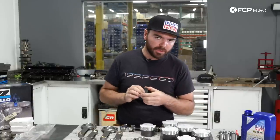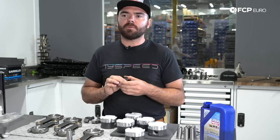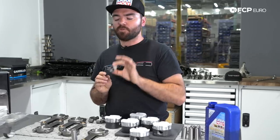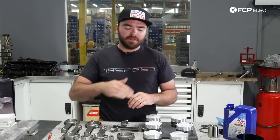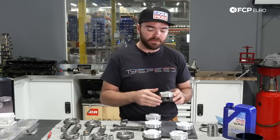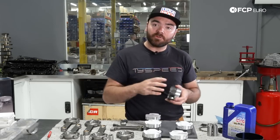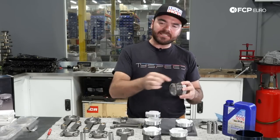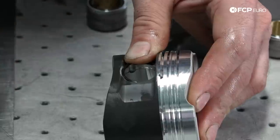These bearings are usually made to the same oil clearance specification as the factory, however certain manufacturers also make them with additional clearances depending on the type of oil, climate, and power ratings. There are many different choices for bearings. One helpful tip: when you have a lot of parts in front of you, I like to do the same step over and over again, basically six times. So we'll install the wrist pin clip on one side of all six pistons first, keeping the process fluid so you don't forget anything. It's easy to forget if you do one full assembly at a time and then walk away.